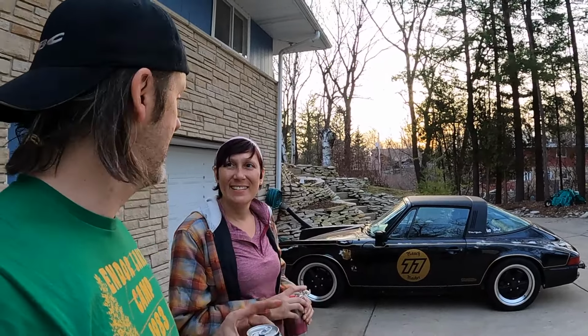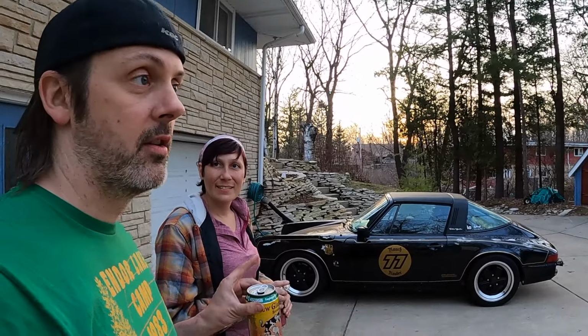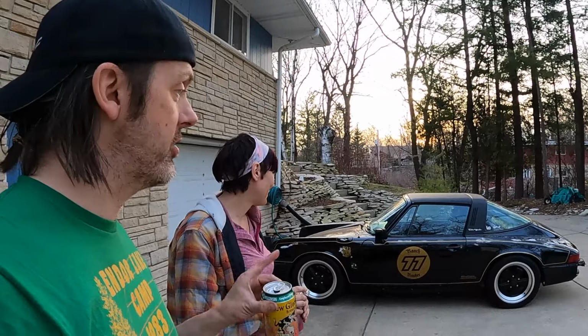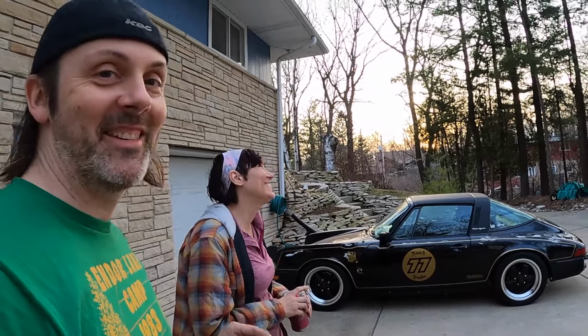Yeah, no more grinds. And then the big thing is, since I ditched the steel pressure plate, and I got that performance clutch that came with an aluminum one, which shaved like 8 pounds off the rotational assembly. Now, when I downshift and I stab the gas to match RPMs, it's like, wow, wow. It's awesome. That was a huge improvement.